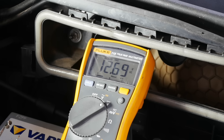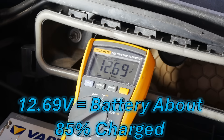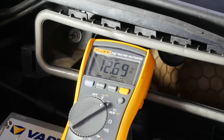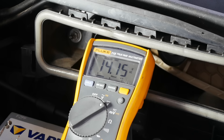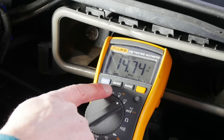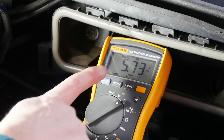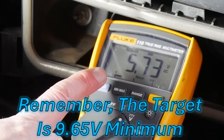Note that the battery voltage is now showing 12.69 which is about 85% charge, so it has dropped a bit from before we did the last test. As you heard, the car was noticeably much slower starting - in fact it only just managed it, and that was just the second starting on a fully charged battery. The multimeter's minimum voltage reading is way down on what we need it to be for the car to start and operate properly.